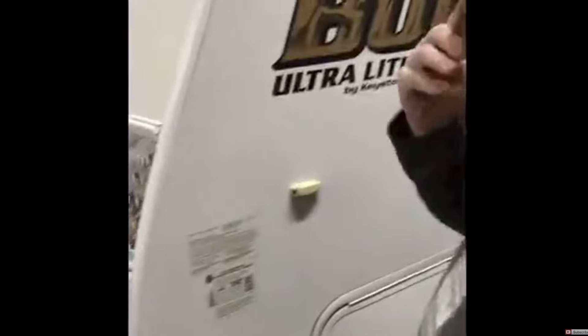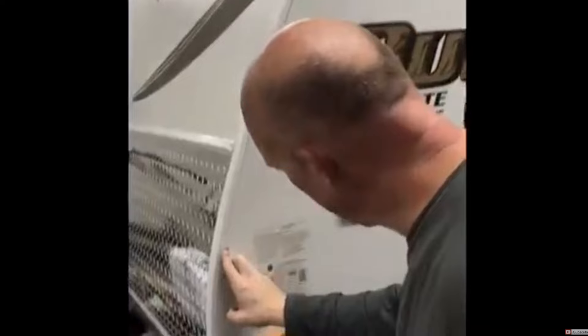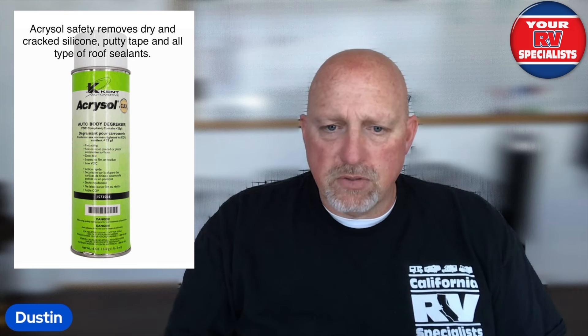That's to try to deflect and block out the water from getting in. If you look at some of my articles, I go into more detail, showing pictures, areas, and what products we use. You're taking a low-grade body solvent cleaner and applying it to the sealant that's there, scraping that off — which if we've all done some type of silicone removal, it makes a nasty sticky mess — scraping and wiping, trying to get that surface as clean as possible before you go back and reseal it.